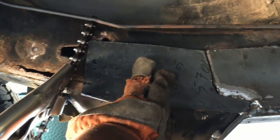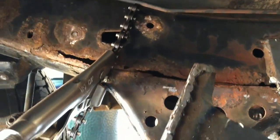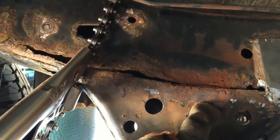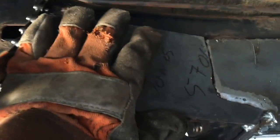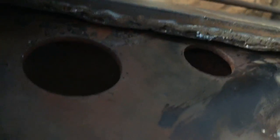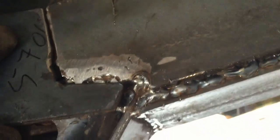Here's the next piece — it's a somewhat square trapezoid with a little L piece at the end. I did put a fillet at the bottom edge. You can see I ground the center — what I was trying to achieve is this is a lip, and I needed to make some space for it while still attaching as low as I can down this edge. I ground down a little bit, and I want to get a nice bite down here. This fits in there pretty tight — I'll weld all the way down, and on top it'll connect to the frame.